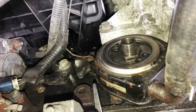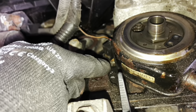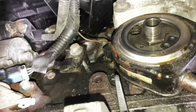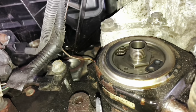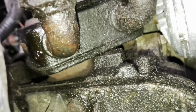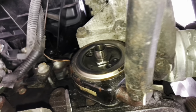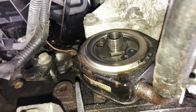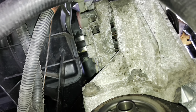Having a look at this, it doesn't seem there's going to be anything really to gain by taking it off. I looked for the gasket - we've got the cooler and behind it there's a rubber gasket that mounts it onto the block, and I can't find one. The only one I can find is for a Mark 1 RS and they're nearly 30 quid, and I'm still not sure it'll be the right size. My idea at the moment is to basically leave it on, clean it up and leave it where it is. Although there is oil spattered around everywhere, it's not actually coming from the gasket at the back. I don't want to take all this off and not be able to get another cooler or a gasket. Best policy is not to disturb it, put the filter back on, and wait till we rebuild the whole engine. But I'm going to leave the oil filter off because it gives me great access to start undoing bits of the alternator. Let's get the alternator removed.